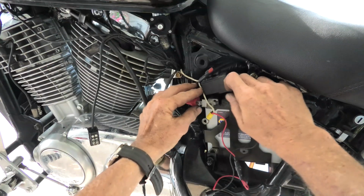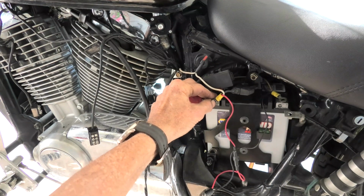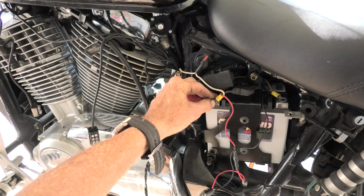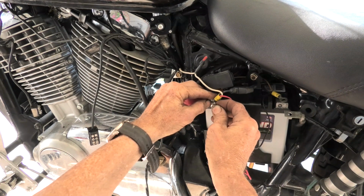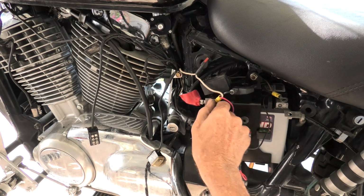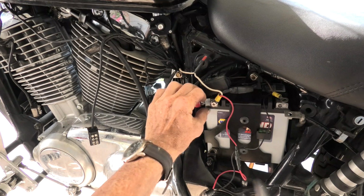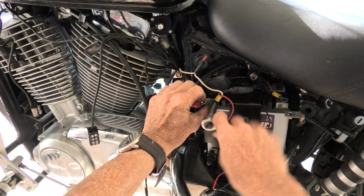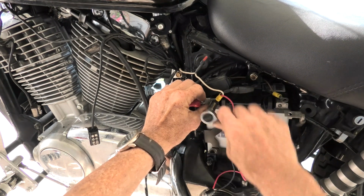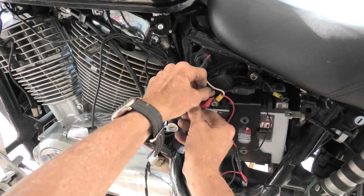And nearing completion, take and hook the battery terminal back up. These extra wires are for extra LED lights that were put on this bike. Yours may or may not have a similar deal, but the main battery cable was down underneath these exterior wires. And that is definitely a 10mm. Used the socket and the ratchet on it since it was handy close by.